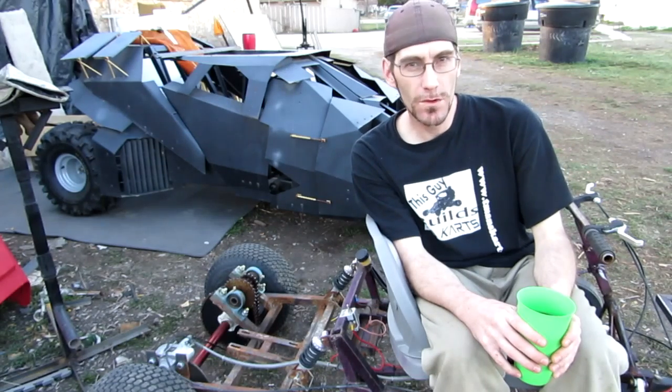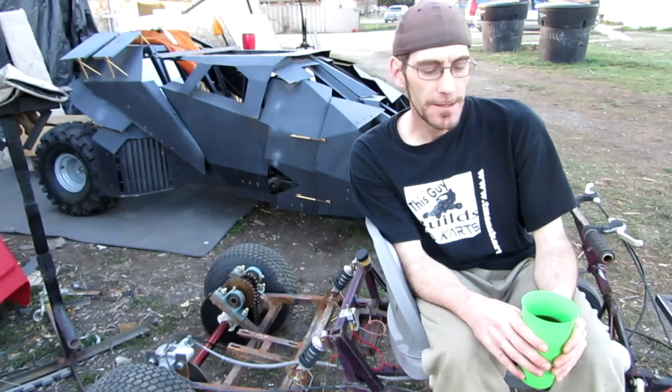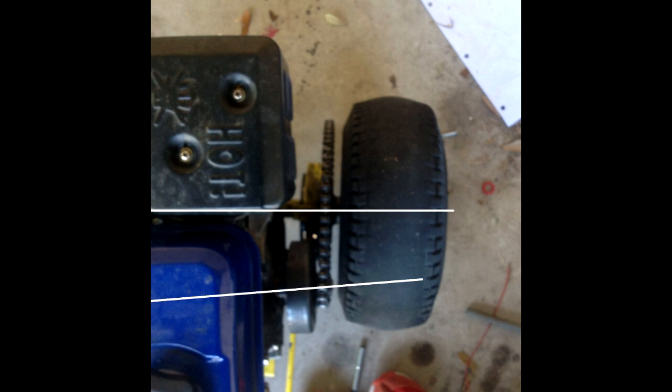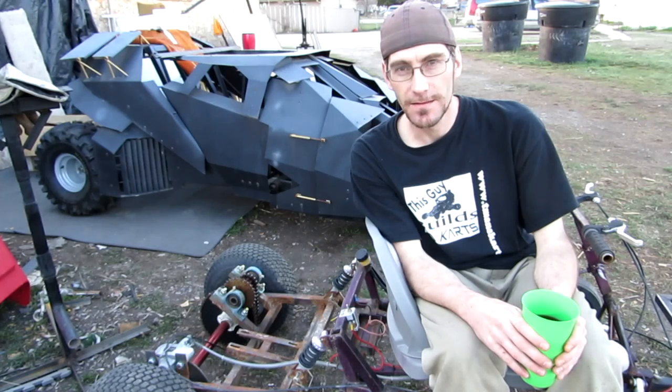Looking at the rear-end picture, it was a little hard to see at first, but when I enlarged it I could see — by looking at the points of the teeth of the sprocket and drawing a straight line down through the sprocket, then a straight line across where his axle is — that the alignment is off. Then looking at the top-down picture, I noticed the same thing: his engine shaft in relation to his axle was also misaligned.